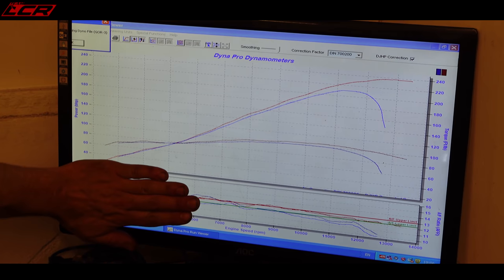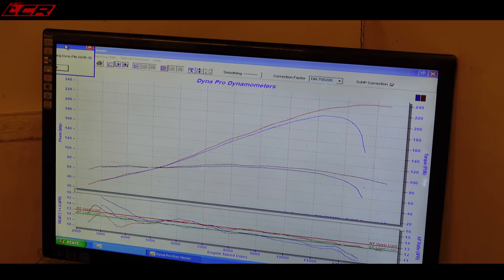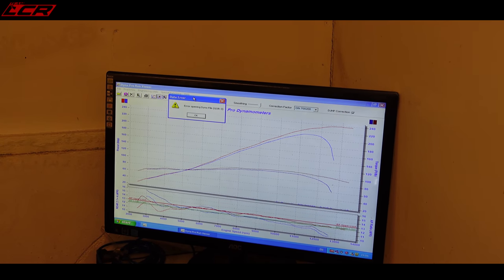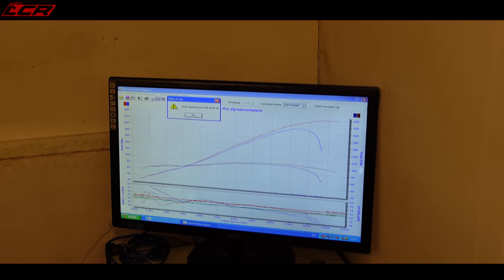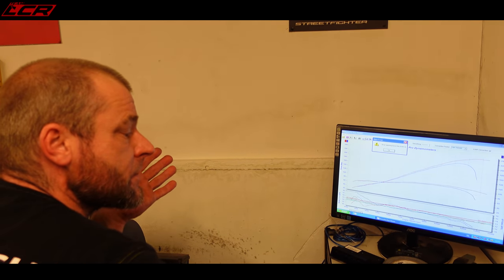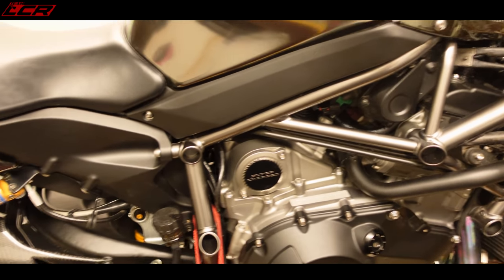You'll be using this area. Yeah, exactly. On the lower throttle positions, 25% is more important. 12.5%, 6%, 4%, which is you cruising in traffic range. If it's lean in that area, then you have to do something about it. Otherwise, your ride is just going to be bad. So now we just have to test it on the road.